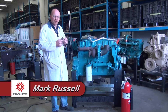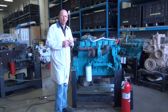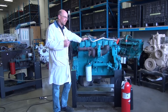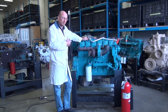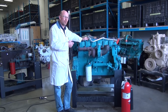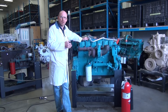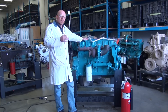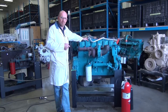We're going to take a look at this style of engine here. This is an NGD diesel engine. NGD stands for New Generation Diesel. It's another International engine, very similar to the others covered in previous training videos. There are NGD videos as well as the regular DT and DTA engines — diesel turbo and diesel turbo after-cooled. Most engines today are after-cooled, taking the charge air through a heat exchanger to reduce temperature, bringing cool air into the engine for complete combustion.